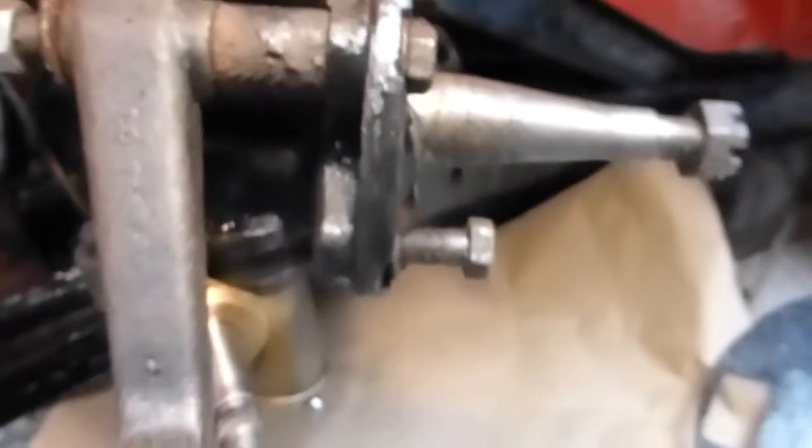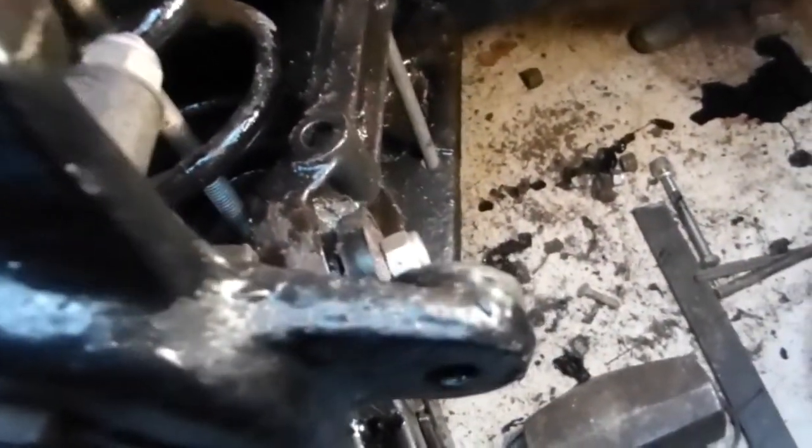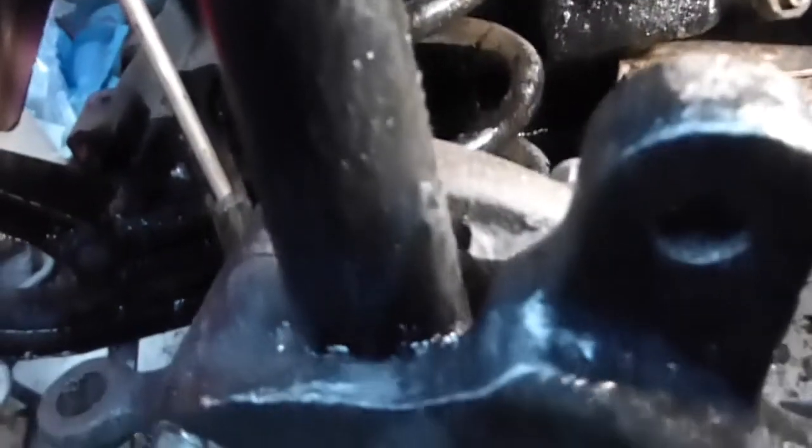The back plate, when that comes on, will slide on behind the nut and then is nipped up tight. I've got the bottom wishbone in and remember you've got to put them in both one side at a time so that you can slide it over the trunnion. I've got the nut in on the top, just catching on the center bar. I've got the guides in ready for when I've jacked the pan up, but I've got to make sure that the stud in the corner and the hole are aligned and clicked in, otherwise it'll jam up.